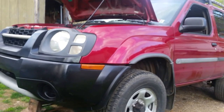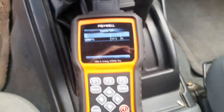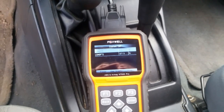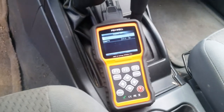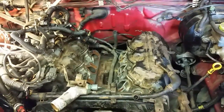So that's about it. The fuel trims are just gross — and if you drive it long enough, the check engine light will come on. At this point I'm basically stopping until I get a head — I'll order a new head and put it on. It's worth fixing: the car is in great shape, perfect body and frame. The bottom line is, if you have one bank showing too rich and you have some minor issues, replace the O2 sensors, but you might want to start looking at other things too. You can also do a compression check. We'll fast forward to my next video where I've got the intake off — couldn't find anything wrong with the intake, and the gaskets are in good shape.